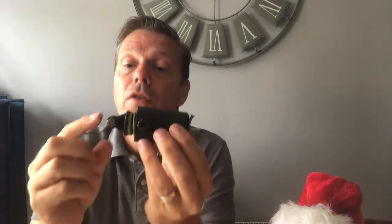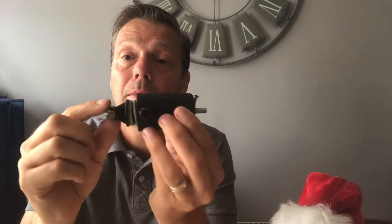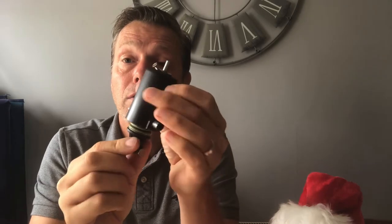I couldn't push the clutch down on my own — I've got weedy arms — so I got my boy to push it down for me. I squeezed in up behind there once I'd worked out what was going on. Once the clutch is fully pushed down you can see that this can move, and you just leave the pin in and the clip, pop that end out, and negotiate it round to get it out.